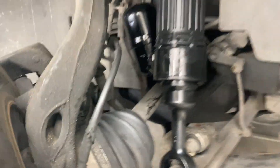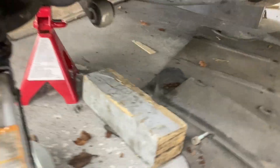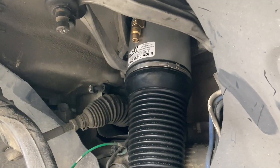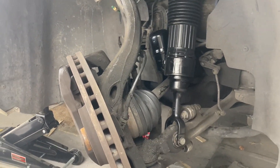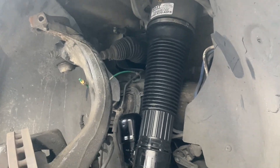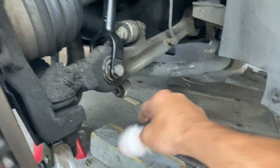I've got a torn CV boot and I wish I'd ordered the half shaft from RMT as well, but that'll be a future project. The trick is I started by disconnecting the sway bar, and I also loosened the sway bar on the other side — that gave me enough downward movement in the control arm to fit the new part. The old part is compressible by hand because it's faulty, but the new one is longer and doesn't fit at first. The upside is that at proper ride height it should sit correctly once the car is set down.